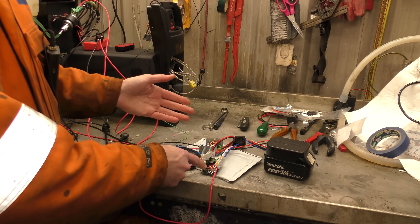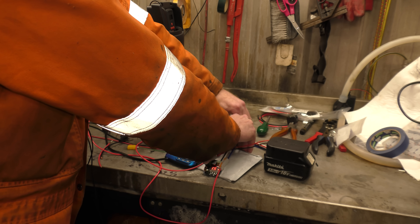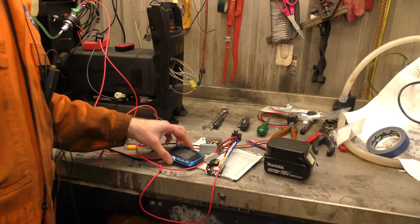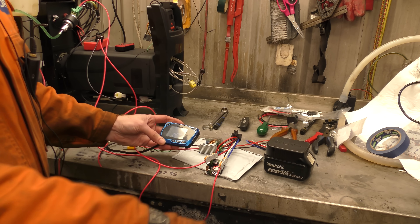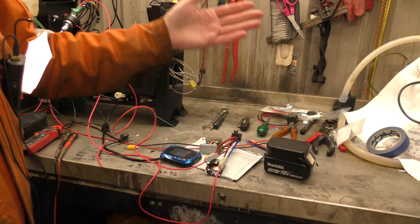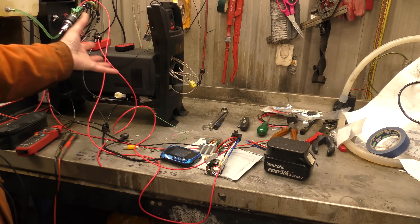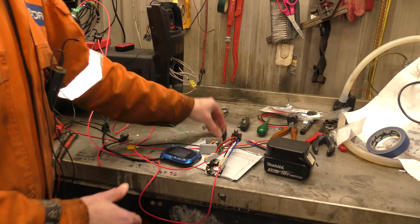Let me demonstrate what happens when the voltage falls low enough that it clicks off the relay. I will turn the relay off by unplugging it — the relay unplugs. Fuel stops pumping. The heater will eventually work out that the fuel pump is now missing and it enters a shutdown cycle, running the fan and cooling everything down — saving your heater from the battery going flat and everything just stopping. Because you don't want it to stop when it's really hot, as basically you've got the full heater housing temperature being heat-synced into your ECU.